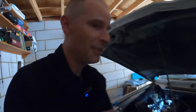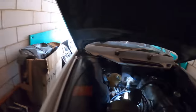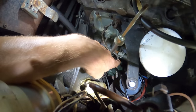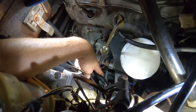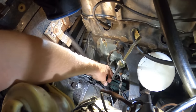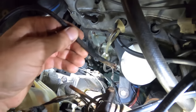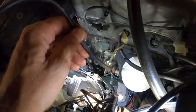Right, you join me back in the lockup after a couple of days' break because I had to order a new bit of pipe. It is extremely warm out here. The old bit of pipe had basically melted going through this little hoop on the side of the earth strap to the engine. I could have extended a little bit of rubber down to the filter, but I thought it'd be better to use the correct kind of pipe, so I had to go to a specialist and get a secondhand pipe and convert the end over. This melted-through pipe also explains why I couldn't suck petrol through — it would have had a pinhole, getting no suction, just air through there.